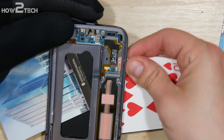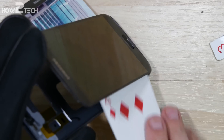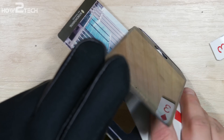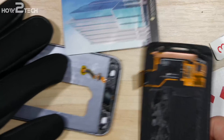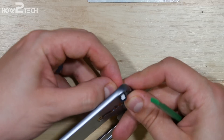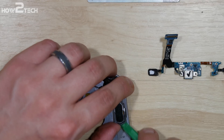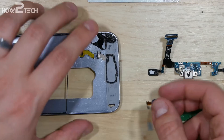Do this on both sides, making sure the device is heated up. Heat up the buttons at the bottom and open the phone like a book. Use your playing card to peel the buttons off of the glass — they're adhered to the glass, and if it's hot enough they will peel right off. Same thing with the home button, then pull the display away. Next, remove the two screws holding the charge port in place. Pry up the capacitive buttons underneath the display and pull them through the phone. Pull the charge ribbon cable off — it has a small amount of adhesive behind it. Then work on the home button, pulling it up and removing it after removing the black adhesive over the top of it.